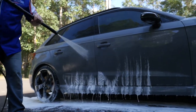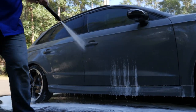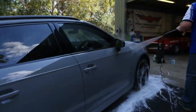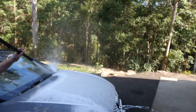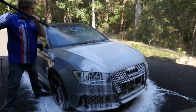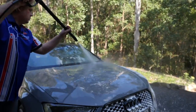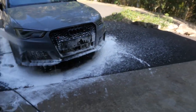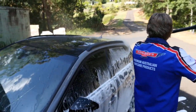The lower painted sections — use it no closer than 30 centimetres away. To make sure you don't miss any areas, work in sections or car panels at a time, working back and forth to use the spray's force to remove the now-loosened dirt and grime from the surface. With this wash technique, it doesn't always clean 100% of the grime away from really dirty cars, but it certainly does help reduce it, more so than just pressure washing it alone. The combination of the foam loosening all the dirt and the machine's water pressure will dramatically reduce the risk of introducing swirls and micro-scratches, were you to have washed the car only by hand.